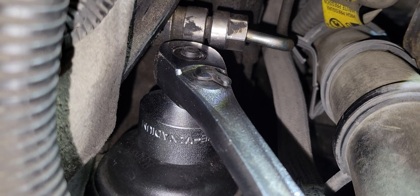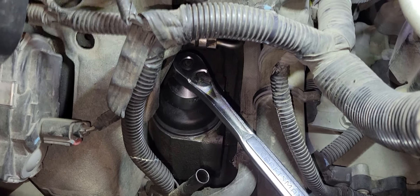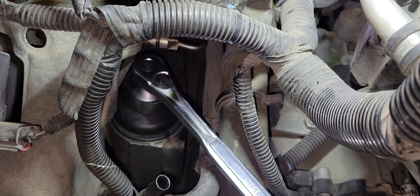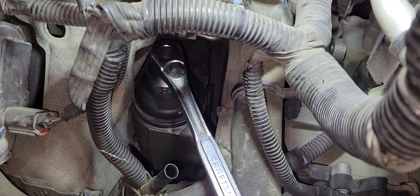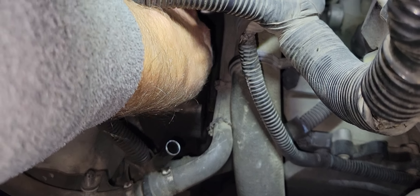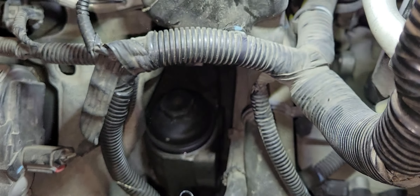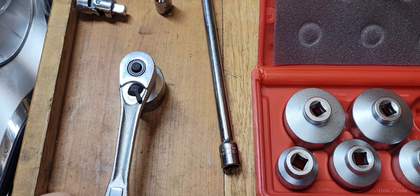This one you can actually unscrew it almost all the way without it hitting, and then it just comes right out. So these Shorty sockets for the 32 mil and bigger ones, they just do a great job of being able to give you access without all the hanging up of the deep well and having to do the reducers and the elbows or swivels. I went ahead and backed it off about 20 turns — and that's just super loose, I can take it right on out. So the best socket for this is definitely these Shorty guys — you get right in there and come right out.